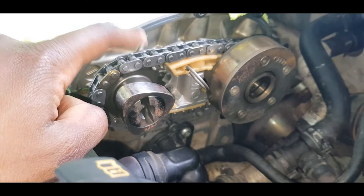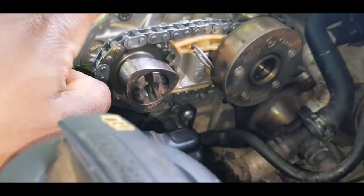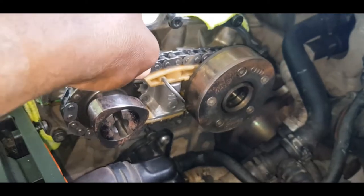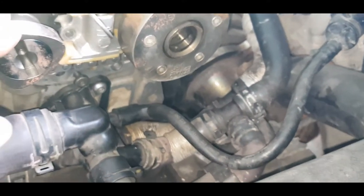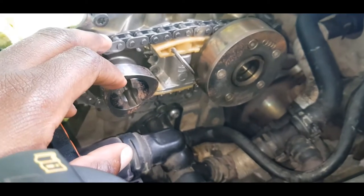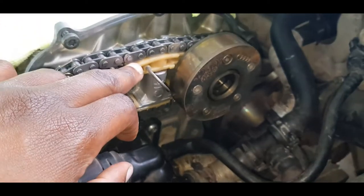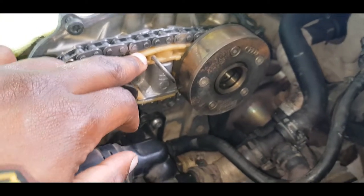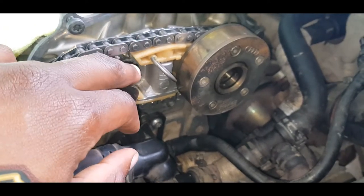And this chain is confusing the heck out of me, because it is so tight, there is just zero play in it. It's sort of as though this chain was actually meant for a vehicle that does not have a tensioner on it. However, the tensioner and the chain came in the same kit.